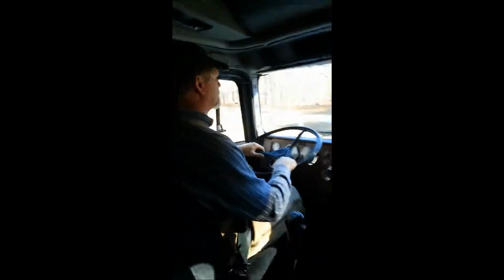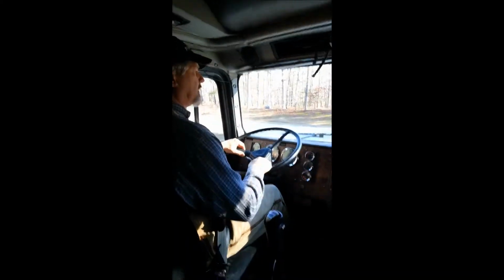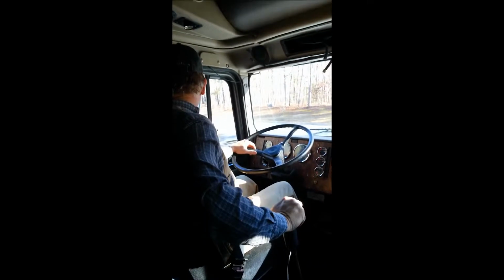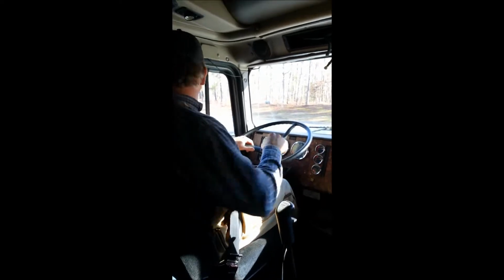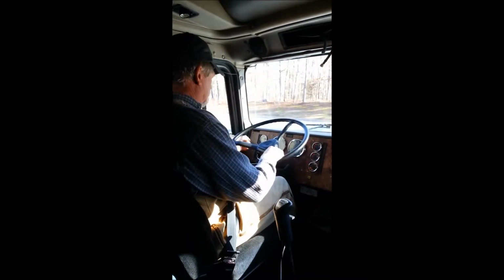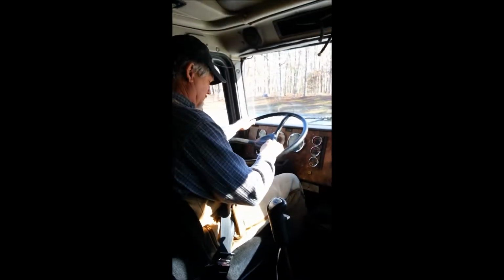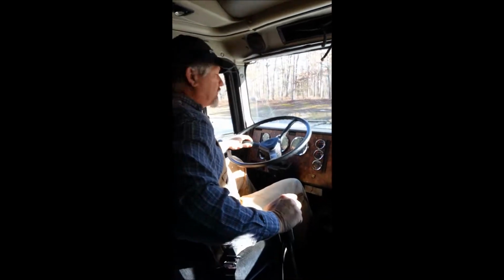In the clutch. A little bit of brakes, and there's the clutch. Stopping at the stop sign. Pre-select. Coming out of there, going over to 1st. I'm in. I'm going to make a right turn. It's a right turn signal. Going straight out, slipping my clutch. I'm going to add a little bit of fuel. I'm going to make a quick shift to 2nd gear.